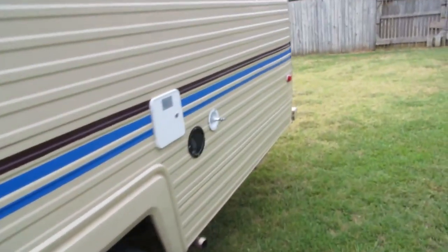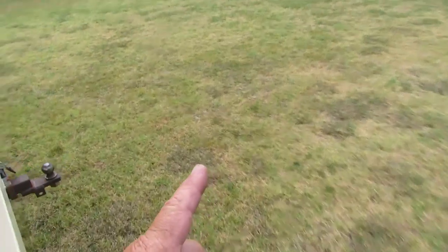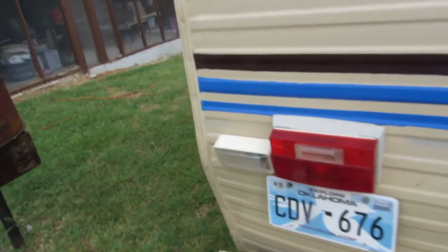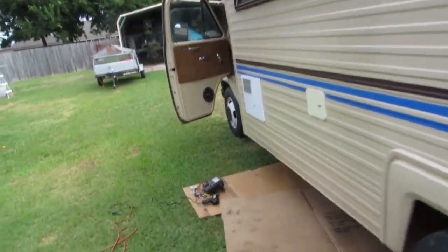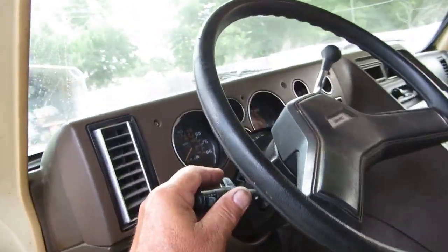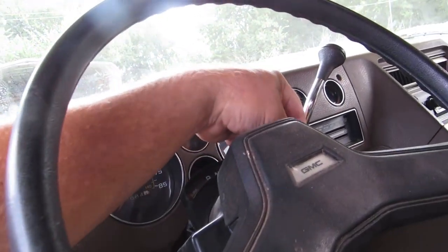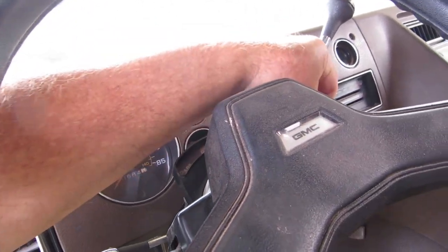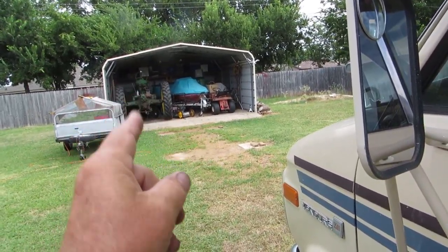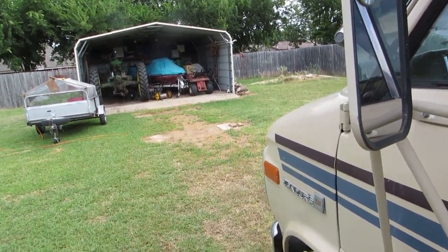The simple fix is to put in a heavy duty blinker, but when I put a heavy duty blinker in and turn the lights on, it blows fuses. The relay isn't bad — I took that heavy duty blinker relay out of the Astrovan and it works fine in the Astrovan, even with everything connected. So there's something funky going on here.